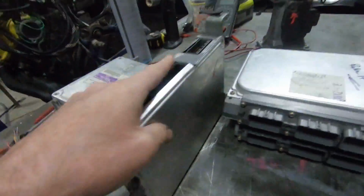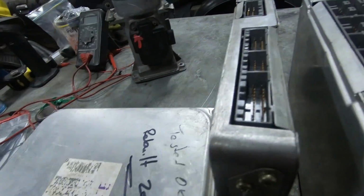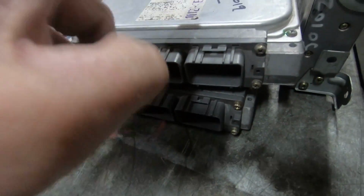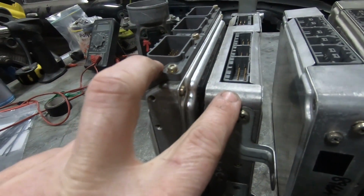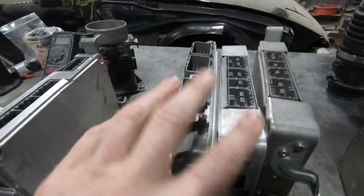And so that's why with transmissions, and I've got a video coming on transmissions, it's hard to link all this information together. So when we look at this ECU compared to that one, 2 rows of pins versus the 4 rows of pins, very similar change happened between the Soarer and that Crown Majesta, Crown Aristo. This one is like the Soarer. They ran a 6-pin solenoid plug on the trans. No temperature sensor in the trans. These ones both run temperature sensors in the trans. And that gives another clue that there's differences in the transmissions, but they're all the same.